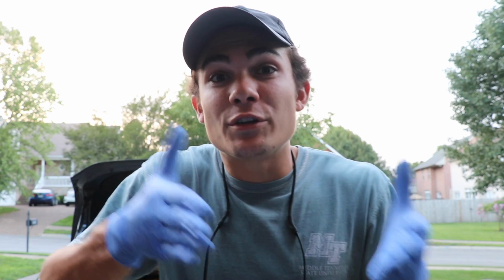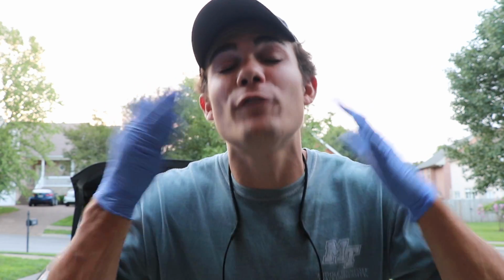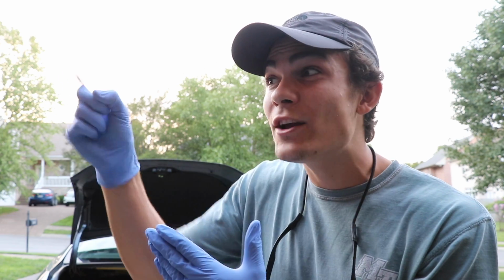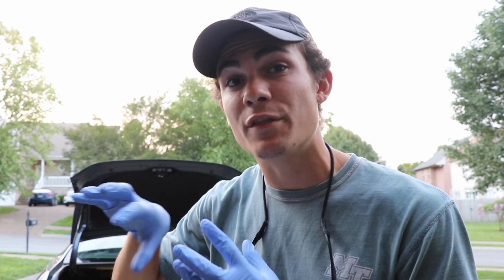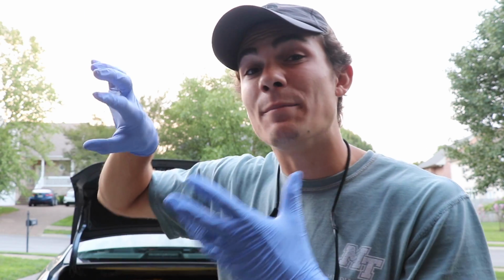When you determine that it is beneath the clear coat and therefore must be wet sanded to be fully corrected, you also need to figure out whether the entire scratch is beneath the clear coat. What I mean by that is there might be deeper parts of the scratch at the beginning, in the middle, or at the end. So I go across the entire scratch, seeing if I can catch an edge on the entire thing, or if I can only catch an edge maybe in the middle.